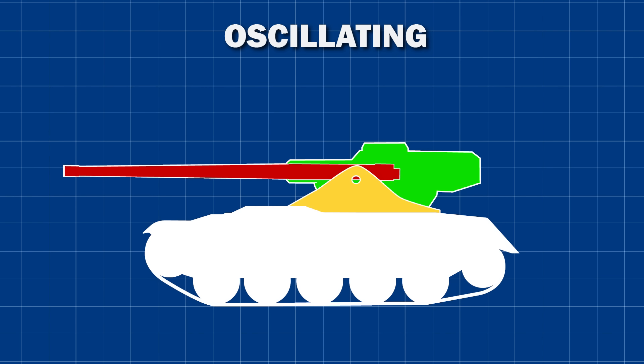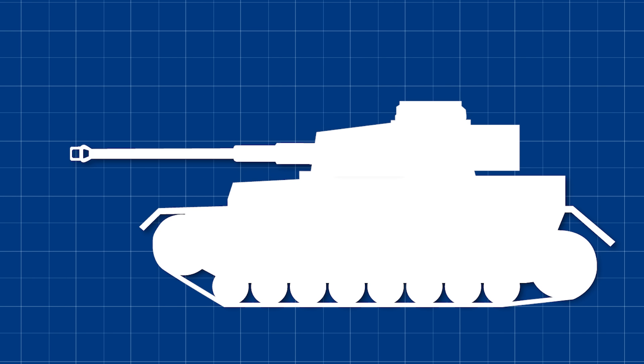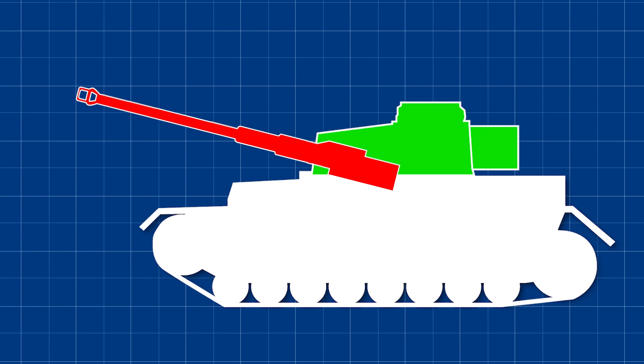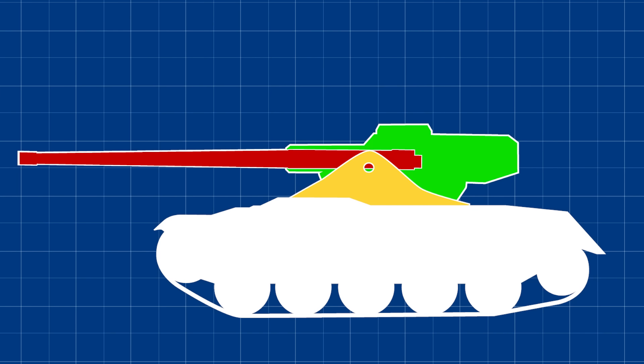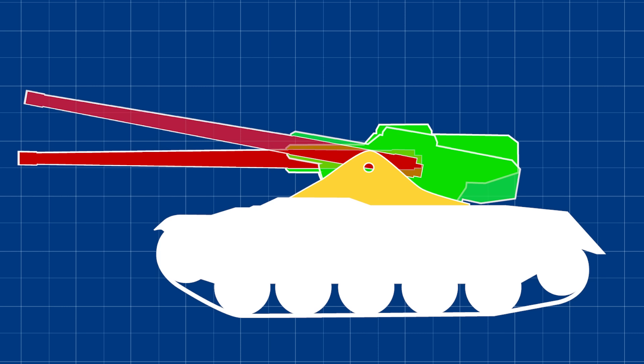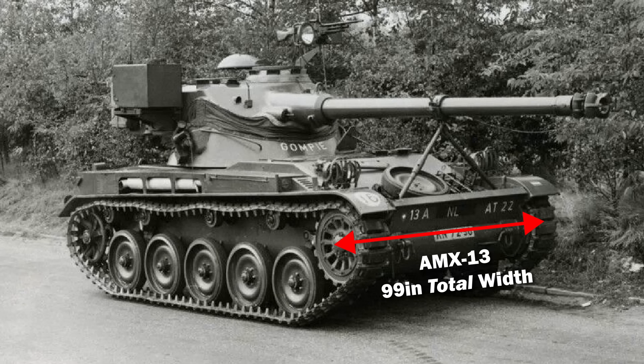But this seems quite complicated — and it does have some pretty huge advantages. Firstly, it means the turret ring can be smaller. You have to remember that the visible gun poking out of the tank is only part of the assembly. Inside the turret, you have the large blocky gun breech that the loader puts the shells into. So when the gun is elevated, i.e. pointing up, the breech drops down, and in a conventional turret the turret ring has to be large enough to allow the breech to drop through it. On an oscillating turret, this is no issue. When the upper turret pivots to elevate the gun, the pivot point is much farther back, meaning the breech drops a smaller distance, so you can get away with a smaller turret ring and, by extension, a smaller turret. The turret ring diameter is also a huge driver in how wide a vehicle has to be, so using an oscillating turret means you can mount a big gun on a small tank, as is the case with the AMX-13.